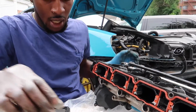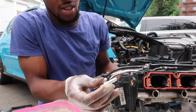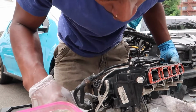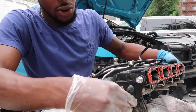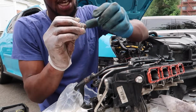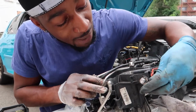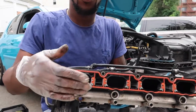Okay, right there. And then the last piece to put in is the locking piece. And you just insert this little piece right here in the side. I could turn it around. It goes right there. This basically goes right there and it plugs the hole. So basically everything is deleted now. You don't need these two other pieces, which is right here, because this don't fit on here now and it won't work. So now you want to go back and grab the little locking piece. Like I told you, you need this little locking clamp earlier, so you want to go ahead and lock that in place. There you go. Lock that right back into place, guys, and that should do it. That should prevent it from coming out. So there you have it. Your intake manifold flaps are now deleted.